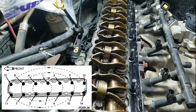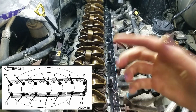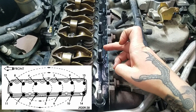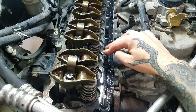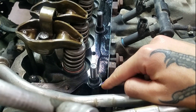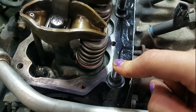There's a very specific tightening sequence, like most heads, that starts from the inside and works its way out in a circular pattern. All of these are going to have a final torque of 110 foot-pounds. The service manual basically says you're just going to tighten all of them to 110 pounds — except for this one. Because it's going through into the water jacket and has the sealant on it, it's only 100 foot-pounds. So bolt number 11 is special — make note of that.